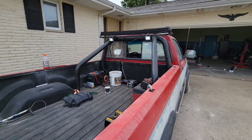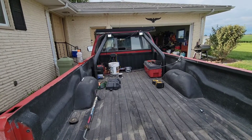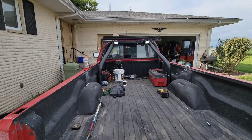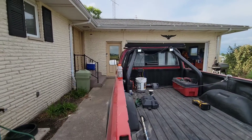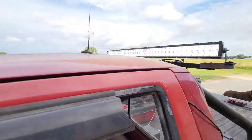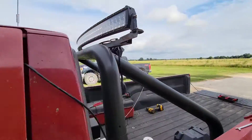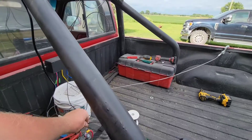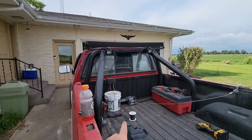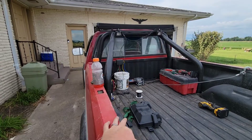There we are — these are installed and working. I mean, they're installed. I don't have any of the wires tidied up — they're just touching the post on the battery right now, because I'm not going to hook the switch up or anything, because I don't have that inline fuse that I keep stressing about. And I think if I do that and make it seem like it's finalized, I might not come back and finish it. But the wires are currently everywhere, I gotta tidy all those up yet. All in all, it works — hit the button, we've got a light bar, we've got pods. The wiring currently looks horrendous, but as for an installation video, that's roughly how you do it. The switch is pretty simple — hook it into one end, hook it into the other end, put your inline fuse close to the battery personally, and then hook yourself to the battery and you're there.